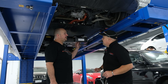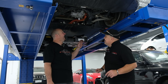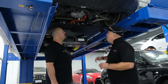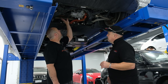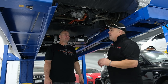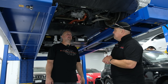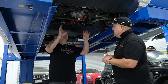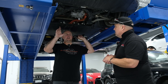First thing you want to be aware of is don't mess with anything that's bright orange. Bright orange means danger — bright orange is a universal EV thing for high voltage wiring. So stay away from there, there, there, and there. To drop the motor out — the front power unit — really, really easy. Where do you disconnect the tail shaft? No tail shaft — that was a trick question, people, because that is the motor.